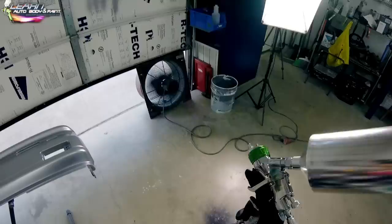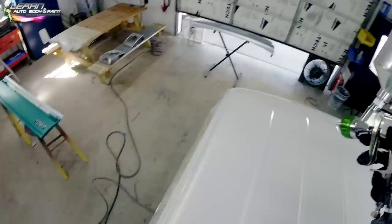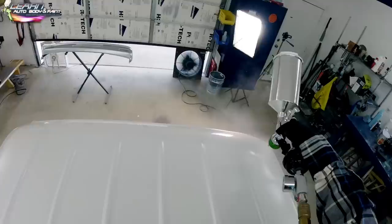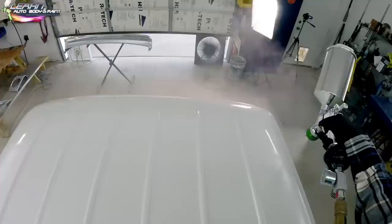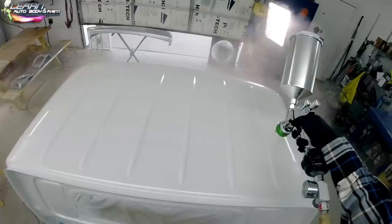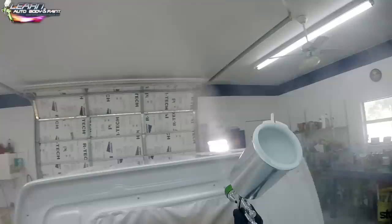Let's start on the roof. Usually when doing complete paint jobs, you want to start on the roof of the passenger side, then walk your way down to the door and walk around the car. On this little mini truck, since we can do the whole roof in one pass, I just jumped up on the bed and we're going to lay the clear coat on. I was thinking of adding a flake, but decided not to because of the pearl already in there.